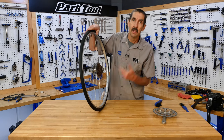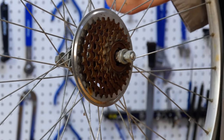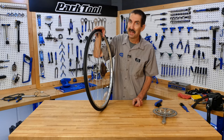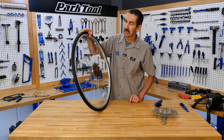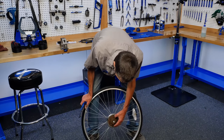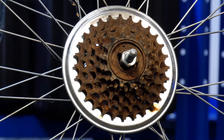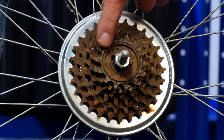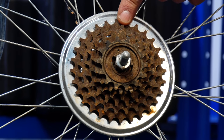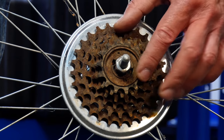That's trickier. A true one speed freewheel is gonna have just the one sprocket. I've got six. I want the 17, can we get rid of the others? Sometimes yes, sometimes no. Sometimes there's only one way to find out, and that's to get inside. We know that this is a freewheel because as I spin the sprockets, the tool fittings remain stationary. In this older system, all these sprockets are held by the first sprocket, which is threaded, so it's a lock ring on all the other sprockets. There's no other tool fittings, only the removal of the complete freewheel and this one.